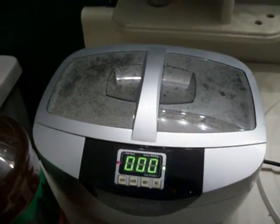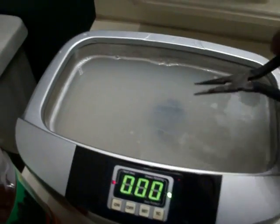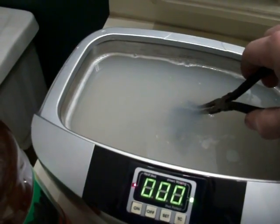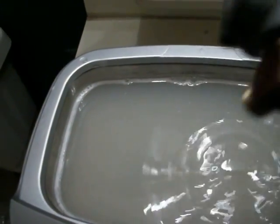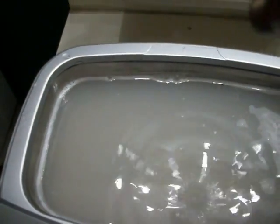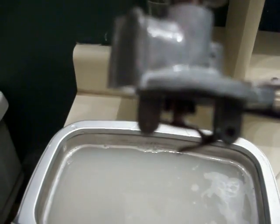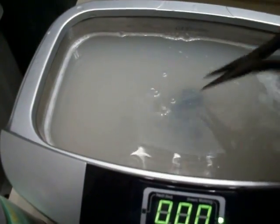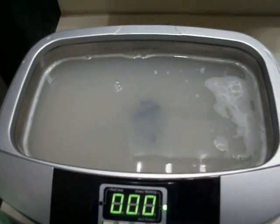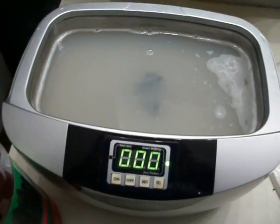I ran it through three 480-second cycles with the heat on. This is the upper part — the needle and seat assembly — and this did not go in the chemical bath, this just went in here with the Pine-Sol water. As you can see, there's just a little bit of crud left in there. The needle and seat is nice and free now — before it was a little bit sticky. That's got it loosened up really well. I'm going to run it through a few more cycles and then after the other piece gets done in the dip, the main body, I'm going to put it in here and run it through again.